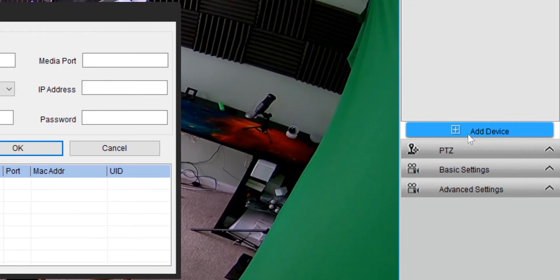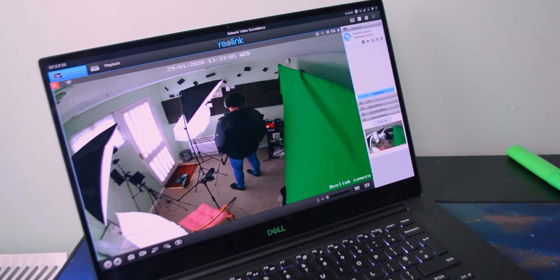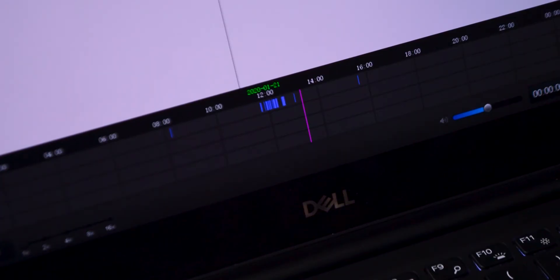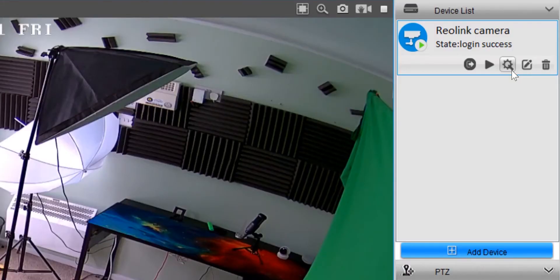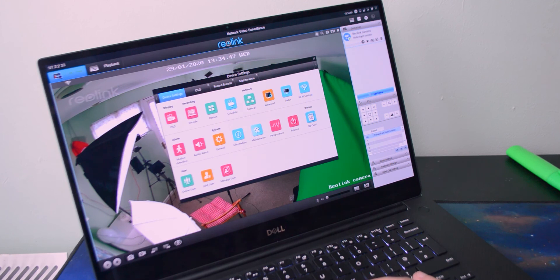Connecting a camera to the desktop app, as long as it's on the same LAN, is super easy — you just click add device and quite often it will add itself before you even click. There's a more complicated way to do it over WAN, but I'd recommend setting it up on a computer in the same room, then moving it — it will still connect over a wide area network. Playback files are in a tab at the top, with a calendar and playback video laid out by time; you click a time zone, click play, and it plays that section. There's also download and screenshot options. The desktop settings very much mirror what's on the phone, with additional options for maintenance — scheduling reboots or updating locally — and a performance tab showing camera stats.